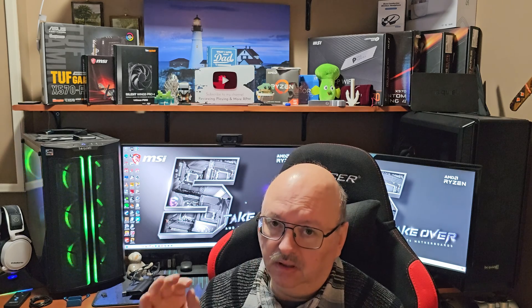I'm still in shock - this has been a system I haven't been able to run for months. But it's working now, which means I can build a system around it, put it in a case, and get it going knowing the motherboard and graphics card are working. I'll put all the different codes in the video that I was reading off. Now if it shuts down again after all this, I'll have to start troubleshooting again. But so far it's running fine. Maybe changing the date and updating the BIOS all together is what did it.